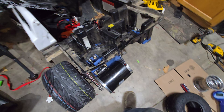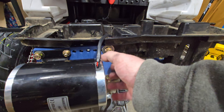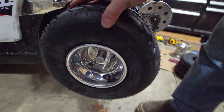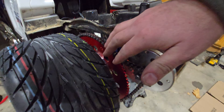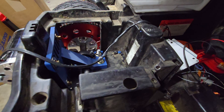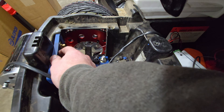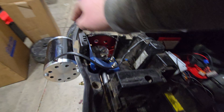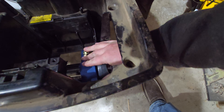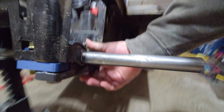It has been a few days and I have made a lot of progress. I designed this bracket here to go over the axle and then mount to this plate, which bolts through the car body into the plate, and the motor bolts onto that plate into the sprocket. I got one wheel mounted up, all tightened up and ready to go. I got the largest sprocket I think I can fit — there's barely any clearance but we'll see. I don't want it going too fast but I have a couple other sprocket sizes. There's carbon fiber in the PETG; this is strong — I don't think it's going anywhere. It is mounted pretty rigid. On this side I just have another axle mount going between the chassis. I have a disc brake that's going to go here, but I want to get this all together and see if it's going to work first.